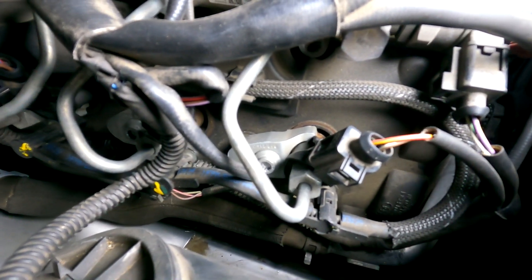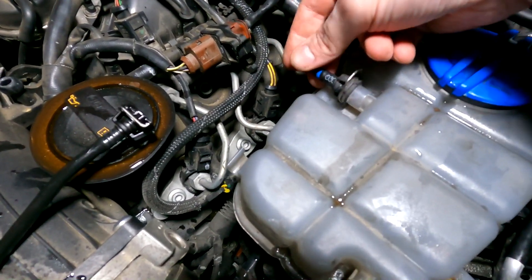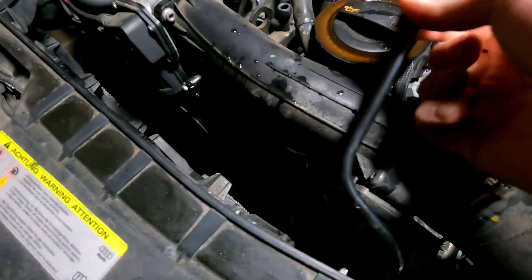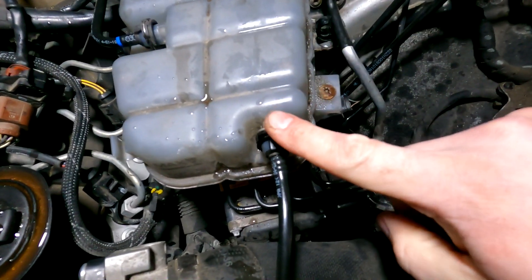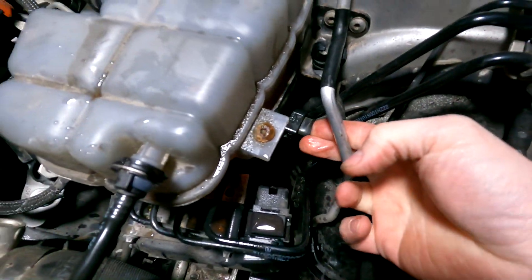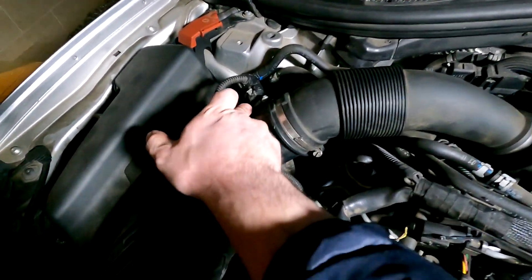The process for these injectors is exactly the same — remove the plug, the high pressure pipe, and the stretch bolt with clamp. Once removed, give the ports a very good clean-up, making sure they're immaculate inside before fitting the new injectors. When putting everything back together, double-check everything: two bolts back in, pipes firmly on with clips popped down, the tank plug reconnected, and the air box wiggled back into position.